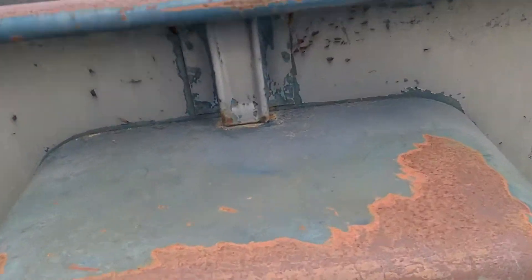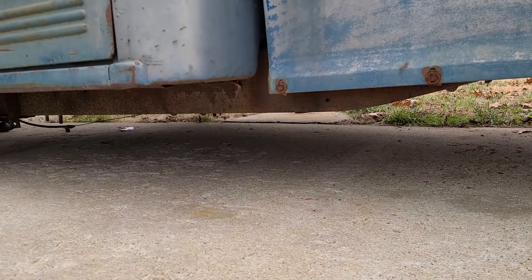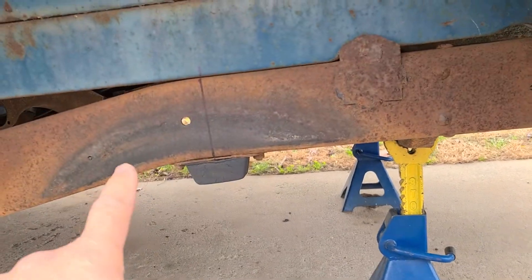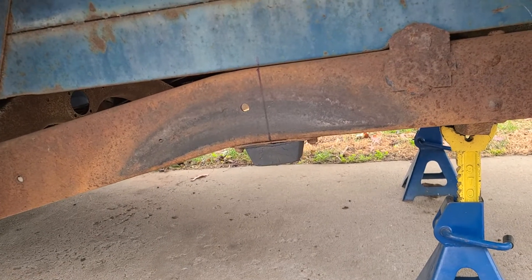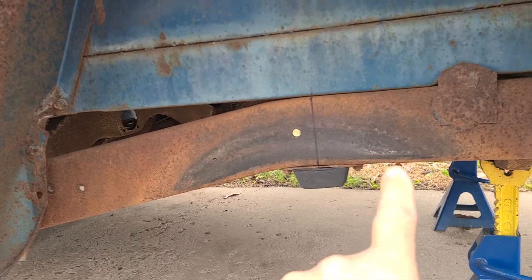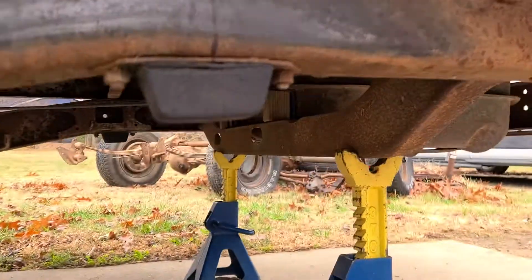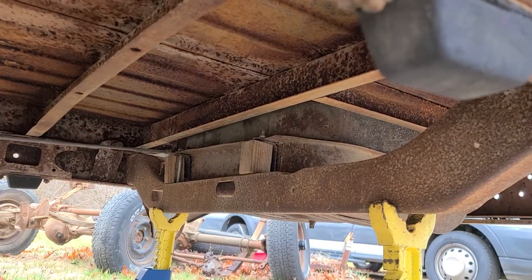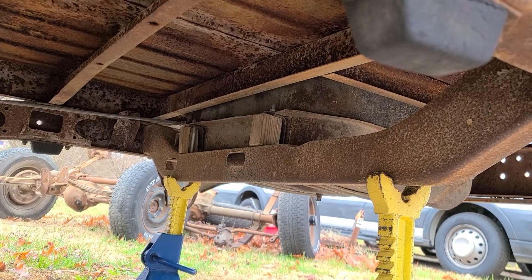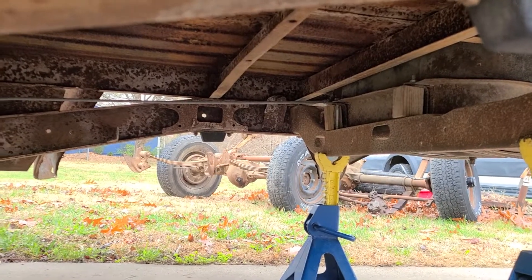Over here on the back: right now there's about 8 inches of frame clearance from the bottom to the ground and 17.5 inches to the bottom of the snubber. The independent rear suspension we're putting in is from an Infiniti G35, 350Z, or 370Z Nissan — 5x4.5-inch bolt pattern. The mounting pads go 9.5 inches forward and 12.5 inches back. The gas tank support brace rivets are going to have to come out; there'll probably be a straight bar going across. Guys use a 69 El Camino 20-gallon gas tank for these. The International Scout axles are going on tomorrow.